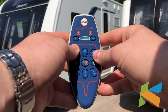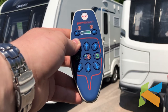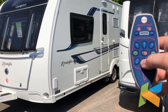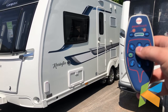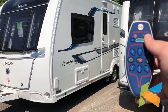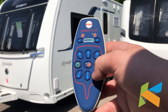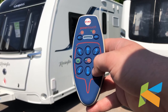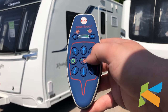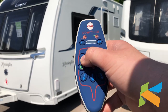There's not much difference in speed. This here indicates the hitch, so we know that this button is going to take the caravan forwards. This one's backwards. The turns on the motor mover are a little bit the opposite of what you think — this one here is on the left, but the caravan is going to go towards the right, and vice versa. If you need to make a backwards turn, you can use the arrows at the back, which will turn the caravan while it moves backwards.